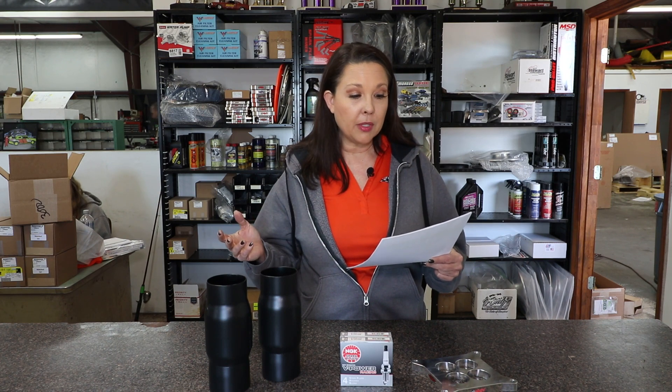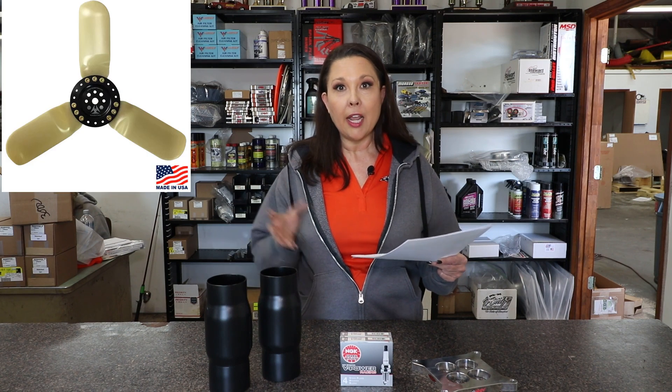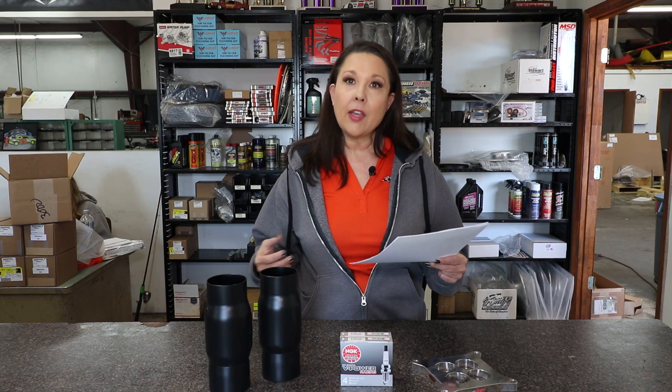When it comes to water pump pulleys and fan blades, Hendron recommends using any of the Jones Racing products or KRC front drive kits along with the recommended water pumps. These are the best, most affordable, and lightest weight options they've found. They draw the least amount of power from the engine. Hendron recommends using the smallest racing fan you can get away with — they like a two-blade fan. They also highly recommend the race fan because it has interchangeable blades, allowing you to run it as a two-blade, three-blade fan, and so on.